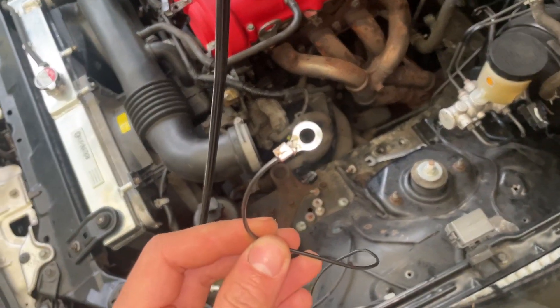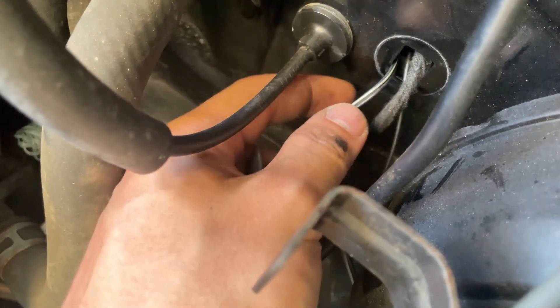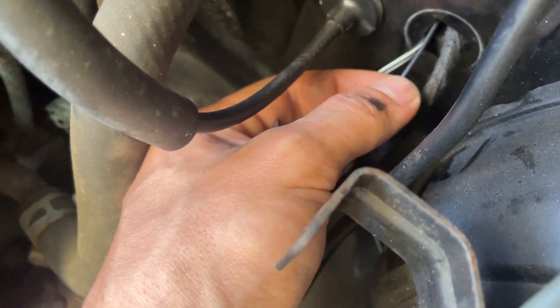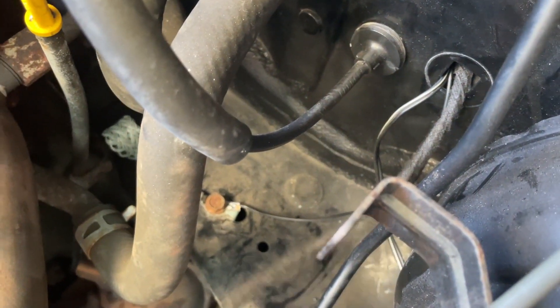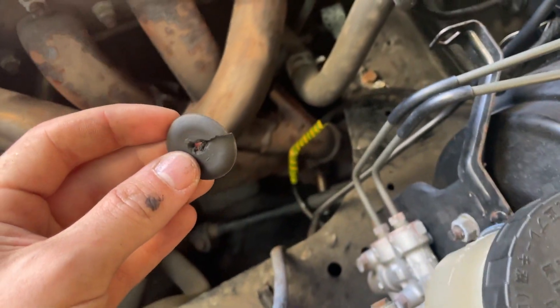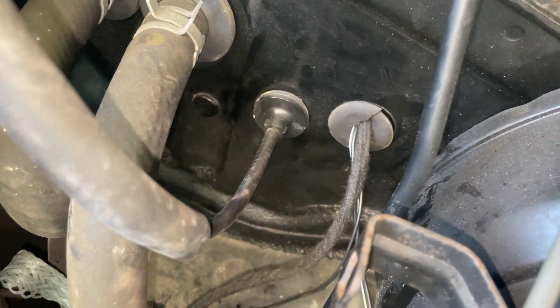So I made a quick ground cable for the AFR gauge. I'm going to mount it here. I ran the wires through — this one is from another project, so these two are the only new ones. This one is a chassis ground which goes to there, and this one is the sensor wire from the wideband O2 sensor. I just made a cut in this one so I can slide through all of them and just push it in — it seals a little bit better.